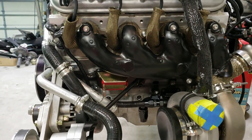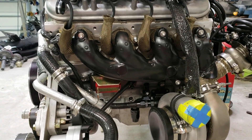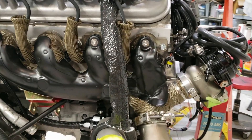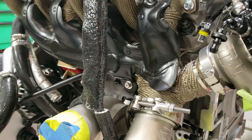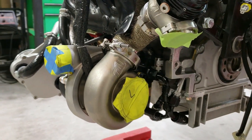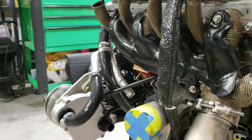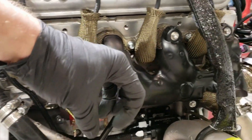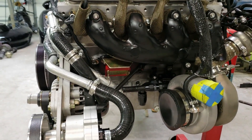These are actually factory LSA headers, or manifolds. Thanks to Sam and Brian from Amp — they let me rummage through their huge pile of stock manifolds to find ones that would fit, and it came out really well. It's just really tight, nice packaging. I basically put a stainless steel V-band on it and added the wastegate. So everything is super compact and tight up against the motor — it fits in the engine bay really well. I can almost stand between the motor and the car itself, so there's pretty good clearance with plenty of room for a good-sized air filter.